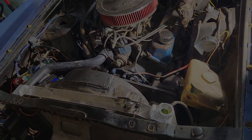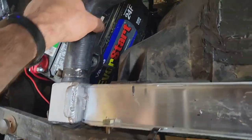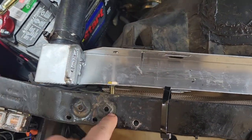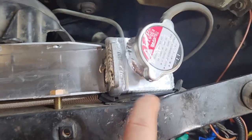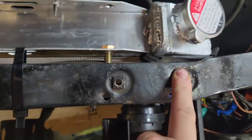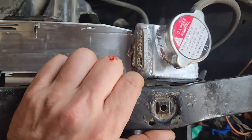Look at that nice aluminum radiator. We've got everything in place. I went ahead and cut this bolt even with the nut so I don't have to worry about it puncturing a hole in the radiator hose. I drilled holes all the way through and mounted these with bolts — two nuts on the end. I put rubber pads from the original mounts in between the radiator and the rad support so it's not bouncing hard against the metal. I also put some zip ties in place as a backup, just in case these rattle loose.